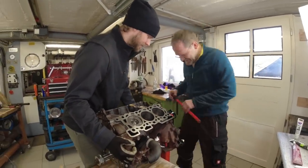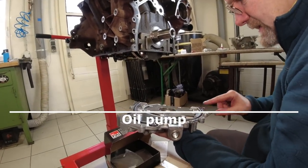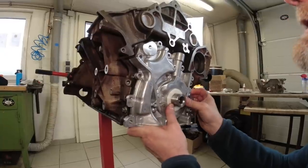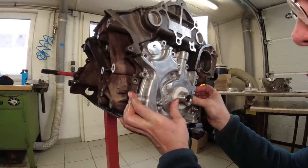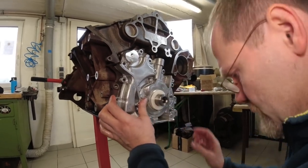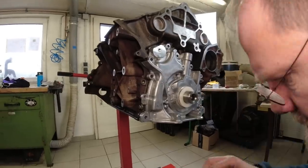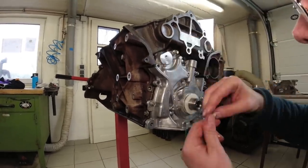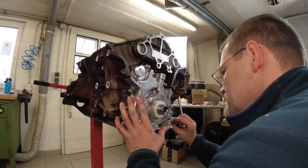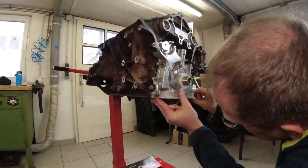And again, what's nice on the pump is that the seal sticks out significantly. The PTFE oil seal gets installed dry. Going on like this. And now I can seat the pump nicely. And I have this alignment tool in, which is supposed to do the job. This is now a little tricky because it doesn't have the locating dowels. And for example, down here, we want to make sure the pump is aligned nicely.